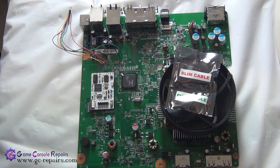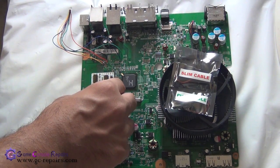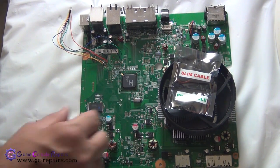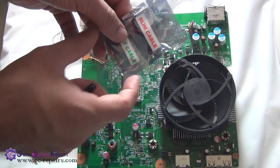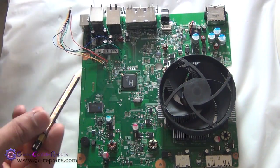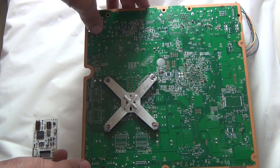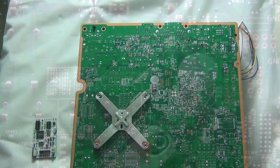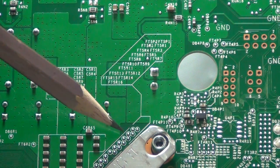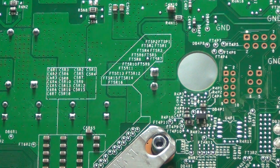Yellow and the long CPU reset — blue or white shielded cable — goes on the back of the motherboard. The yellow cable for Corona version 1 is a smaller cable, so you have to use it from the fat cable set. The yellow wire goes here, and the blue CPU reset cable goes under the X-clamp at CR511, pin number 1.